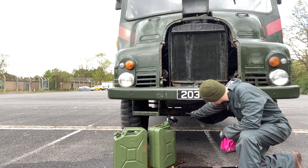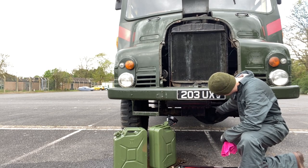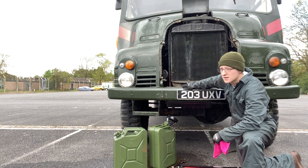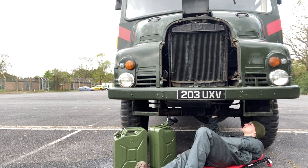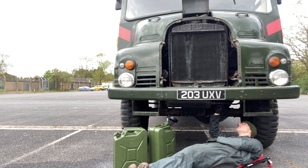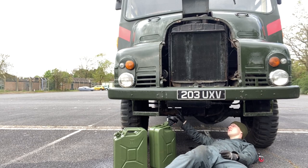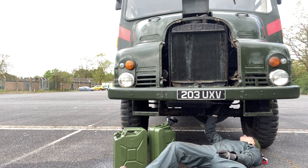We now have the issue that it's going to the heat exchanger but then not coming out the other side to the drain tap. If it's not going through the heat exchanger, it's possible it's not actually circulating throughout the Green Goddess, which obviously is not good. I can't get this end of the hose off the heat exchanger because this bolt is absolutely mullered. So taking off the drain tap here, I'm going to try and force air through and put the flow on it - if I see any reaction I know it's at least clear. Blowing into it, it doesn't seem like there's a blockage at all, which is a little bit concerning.